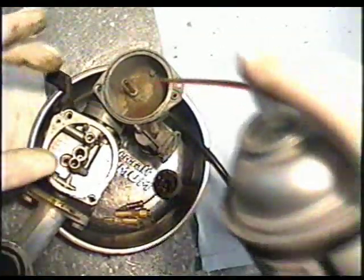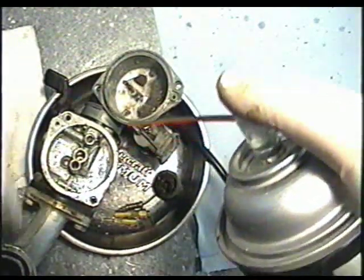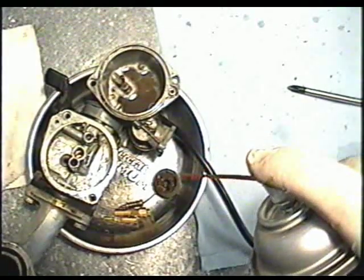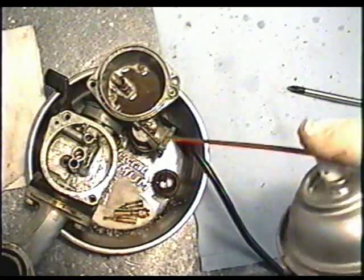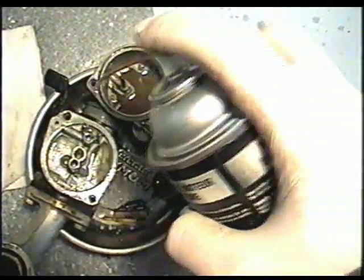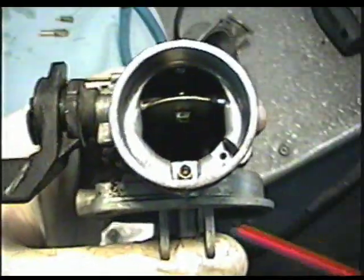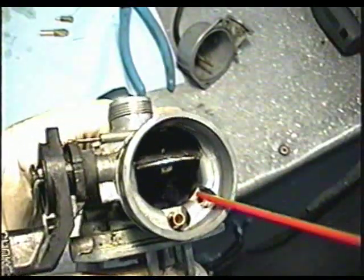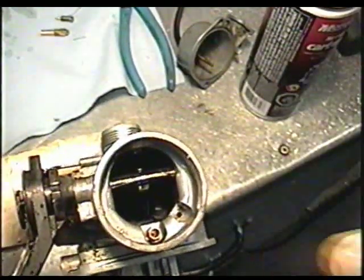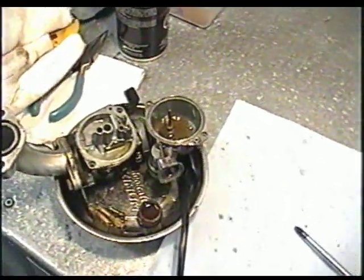Now I've got all the parts in a container and I'm going to spray it with some engine cleaner first because it's really bad. The reason I'm using engine cleaner first is because it's thicker — it's going to sit there and dissolve the dirt. I'll come back with carb cleaner and finish it off. Spray all the jets, inside all the holes, and inside the hole where the needle goes. Also spray some carb cleaner inside the venturi and inside these holes over here. Wear safety glasses doing this because sometimes the fluid will spray out of another area and go right in your eyes. Now I'm going to let that sit for a good hour and then I'll come back and scrape it off.